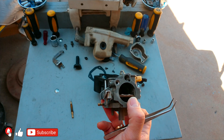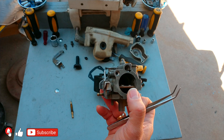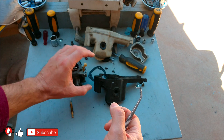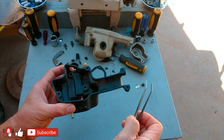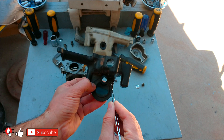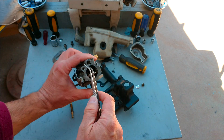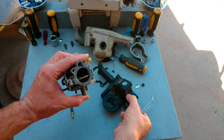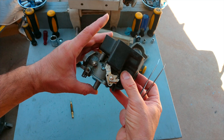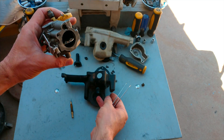Here is what can happen to the motors, and this is extremely important. It could happen to any outboard motor as long as they don't have an air filter. Let me start with the lower part of the air box — the airflow goes from here, and take a look guys, there is a little hole in the air box. That little part goes to the carburetor over here. Some carburetors don't have the air box — they're just plain carburetors without an air box — but you can still have the same problem.